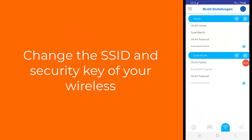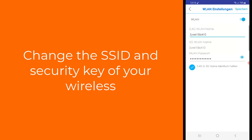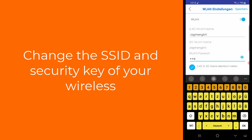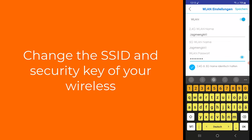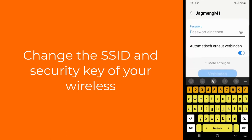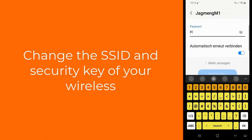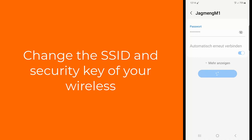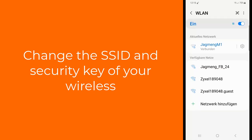Next, I install the second satellite in the extended back side of the building. In the meantime, I show you how to change the SSID and security key for your wireless. You can change the 2.4 and 5 GHz SSID using the same or different names for both networks, and also change the key. If you tick the little blue bar you can have two different names. After applying this, you have to reconnect your phone with the new SSID and key so it has internet access again. Make sure to note down the new password.